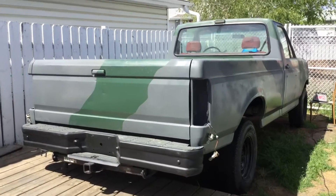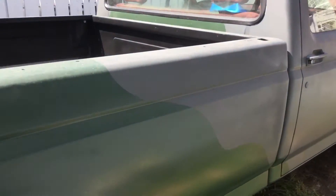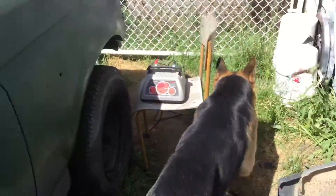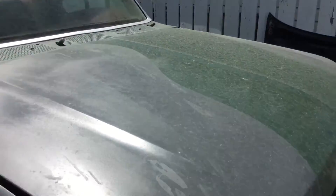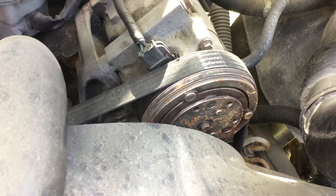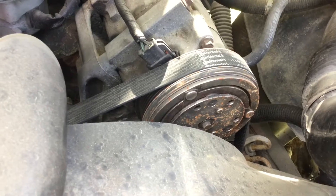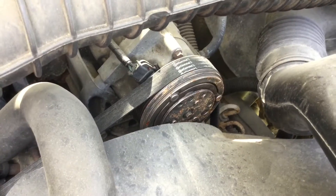This is our 1993 Ford F250 5-liter project vehicle. It's a little dusty right now, which doesn't help the overall appearance. I have an AC compressor right here — I've replaced the clutch on it and made sure it's shim correct — but I'm having it engage and then disengage when I'm driving. It seems like when it's engaged, the belt is actually slipping.